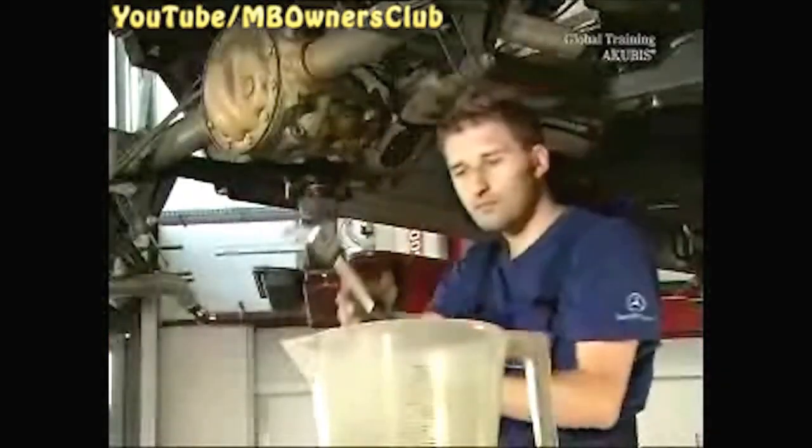In the axle drive there's gear oil which must be let out. Before you go on working, check the gear oil for defects. You'll recognize these as foreign bodies in the oil. With your finger, test the oil in the outlet. Another way to notice damage is the rough running of the bearings or axial play. Should you find damage, then you must renew the axle.